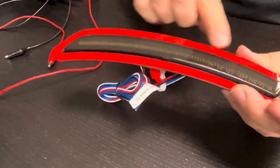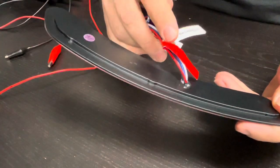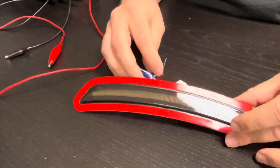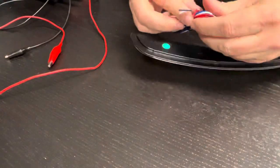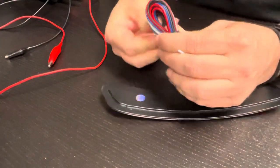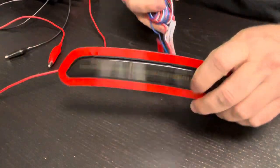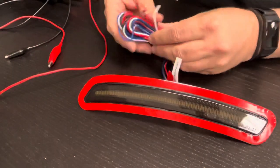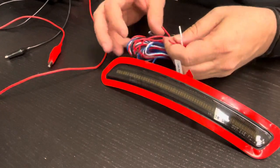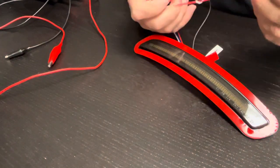It's got 3M tape around it and a plastic form piece on the back. All the wires are labeled with what you need to hook them up to. This box does include wiretaps, but personally I don't like using wiretaps — I would either solder the connection or do a quick twist tie with some shrink tubing and heat loom.